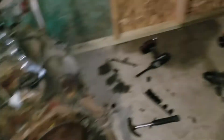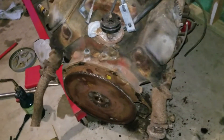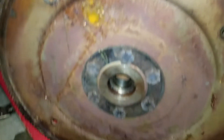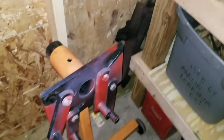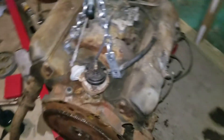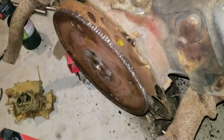I'm hoping we can get this unhoisted with the flywheel on, just because I wanted to keep the flywheel on. But if not, we can pop that off quick — it's just those six bolts. The easiest way to do this, if you have a stand like this — and I think they're all pretty much the same — is pull the pin here, put that aside so you don't lose it, pull that out, and we're just going to mock this up on the block. Then we can lift the block up to the stand height and go from there.